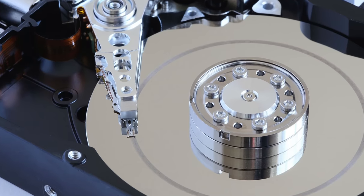Back to RAID 5 — you might be thinking: what good is parity when there's a head crash or an entire drive dies? The beauty of how RAID parity is calculated and stored is that if errors are limited to a single drive, it doesn't matter how catastrophic they are. You can pull the drive out and throw it in the dumpster, and your data is still fine. You put in a new drive, and the RAID system rebuilds the missing data from the parity information on the remaining drives. That process can take hours or days for large RAID volumes, but as long as a second drive doesn't fail before the rebuild completes, no data is lost.